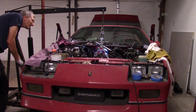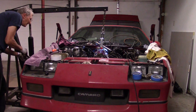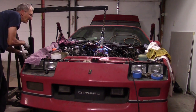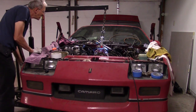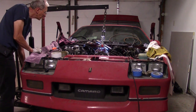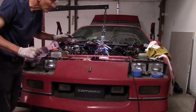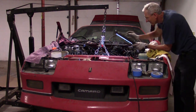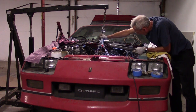Just a few extra comments while you're watching the engine being jacked. I'm doing this project most of the time alone and single-handed, so you're going to see this engine come out with me doing it by myself. I got the bell housing bolts out almost all from the top. The upper bolts came out by removing the hood and using a ratcheting 9/16ths end wrench with a flexible head — that thing was just golden. That got the upper bell bolts out.